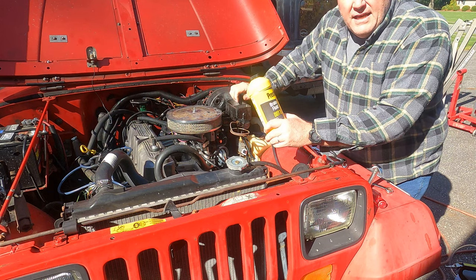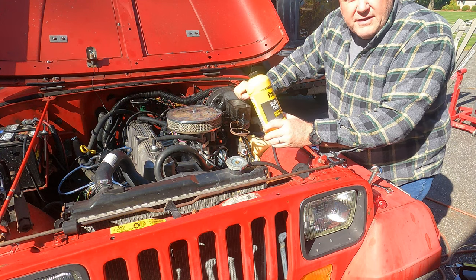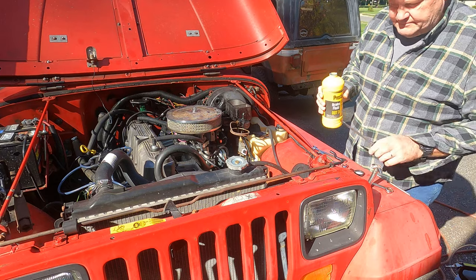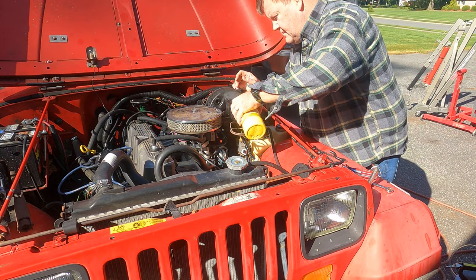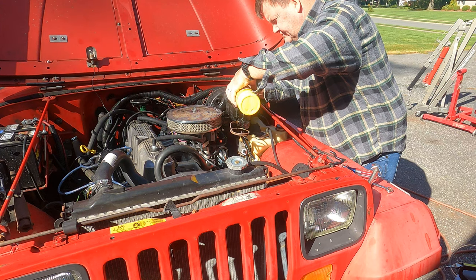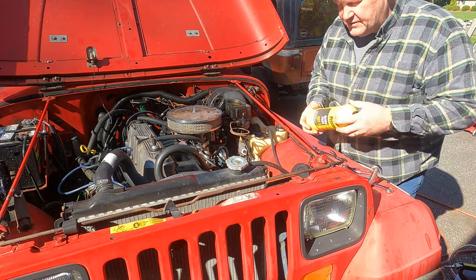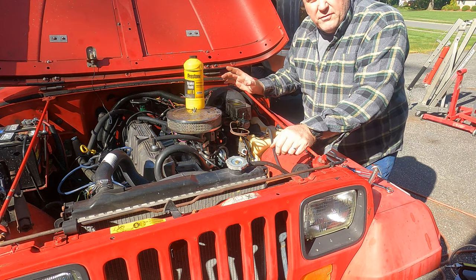So for all those reasons, kind of like an oil change almost, you want to do it frequently and do it as proper maintenance. And so we're going to fill up this reservoir and we'll go ahead and start bleeding. Now I filled this up pretty far because we're going to lose some. We're actually going to pull out the old fluid that's still in the lines and down at the calipers and in the wheel cylinder in the back. So that's going to take up some of the extra space. But we'll keep checking the reservoir and top it off as we're pulling stuff back out.